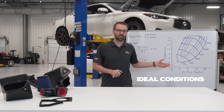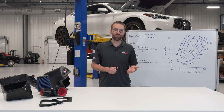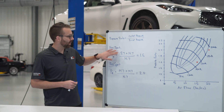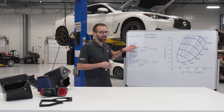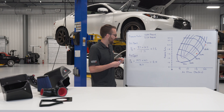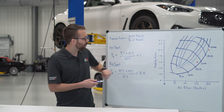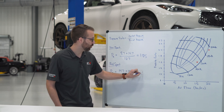This is what the graph looks like under ideal conditions, meaning air going into the compressor is completely unrestricted. However, during testing we've seen a pressure drop of up to 2 psi at the compressor inlet with the factory intakes. Outlet pressure stays the same because the factory map sensors report absolute pressure values and are unaffected by atmospheric pressure changes, but inlet pressure gets reduced by 2 psi. This changes our result for the non-sport from 1.6 to 1.85, and for the Red Sport from 2.0 to 2.3.